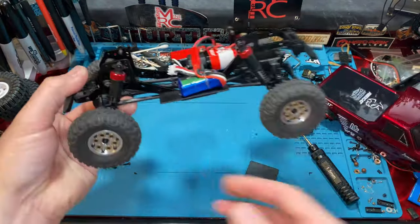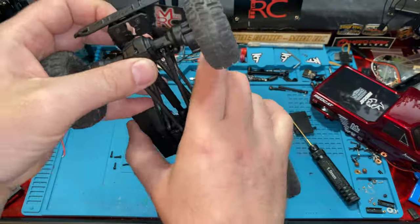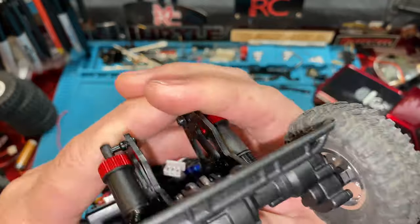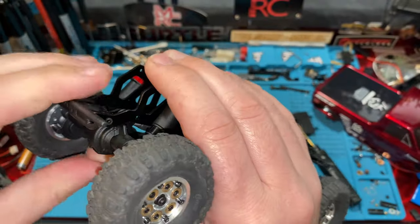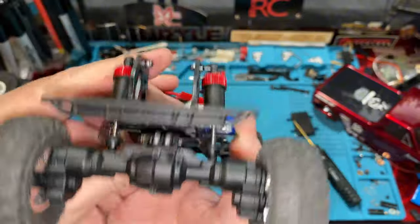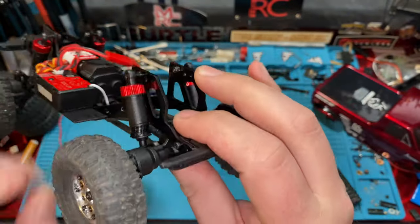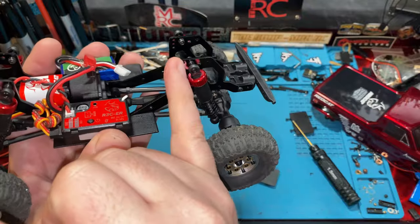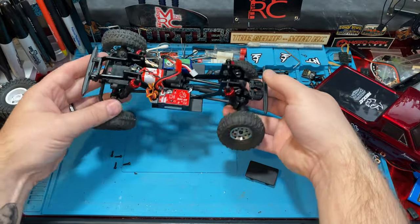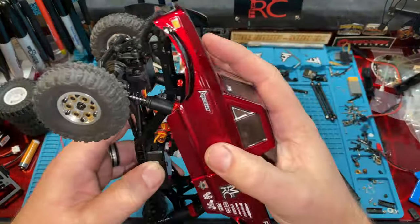We'll probably, when we do the rear links, shorten them just a little bit, by like 1 or 2 millimeters, just so that our diff clears this a little better. And then you can see our next hit point will probably be these trusses on the axle, so we might trim those down because they may hit on the chassis just a little bit once this is able to compress a little more. We'll move the shocks to one more forward position, it'll drop it just a little lower and give us just a little bit more flex. Again, we're not going for the flex as much as we're going for lowering the truck.